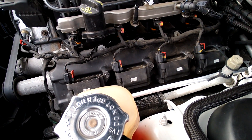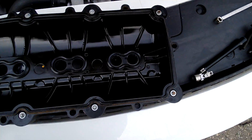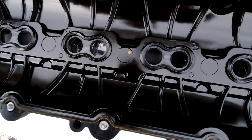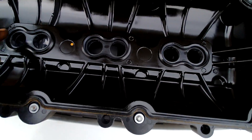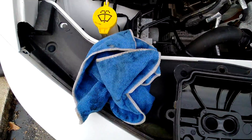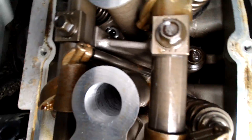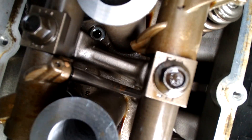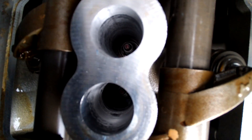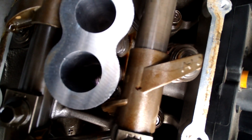I took the valve cover off the other side. As you guys can see, the valve covers are pretty good here. You can see a little bit of grease right up in there, but not on that side — that's just the way to lean in. That's the bottom part. He wanted to see if there was any oil in the holes. You see no oil — that's where the coil packs go, right here. There's no oil down there. Where the spark plugs go, it's nice and shiny.